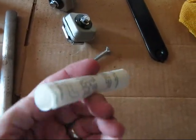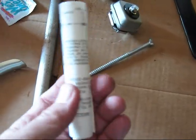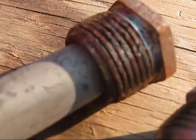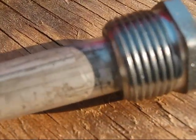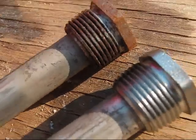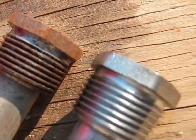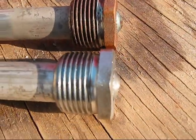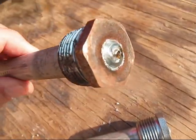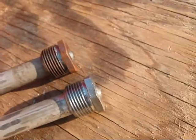This is actually a sticker — they want you to put it on the inside of the water heater. So obviously there's been some type of prior problem with this and they're trying to address it. It's a good little note to read. One last thing about changing your anode: here are two little anodes — new ones I cleaned up — but this one is straight out of the package, and as you can see it's a real beauty of rust. And here are three other packages that I cleaned up with my trusty wire wheel. So you can ask yourself, which one would you like to install? This is something Suburban could definitely work on — get a little better packaging, so people who stock replacements for their water heater won't find them all rusted straight out of the package. Luckily the wire wheel does a great job at bringing it back to where it should be.